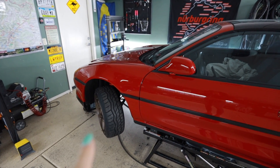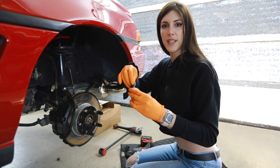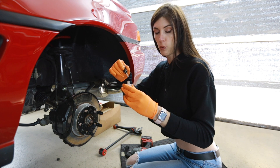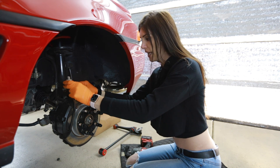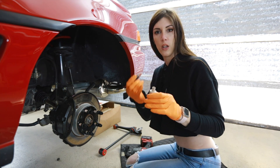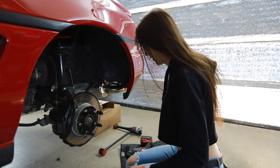Now I'll have my roll center and bump steer correction kit on this car, with the exception of the rear — I still have to figure out how I'm going to adjust my bump steer back here. I have the roll center plates but bump steer is still going to be a little off. It looks like what I have to do is make a plate that will lower the rear tie rod where it mounts to the spindle, and that will correct the geometry back here. I'll mark these bolts with nail polish even though I have to get an alignment anyway.